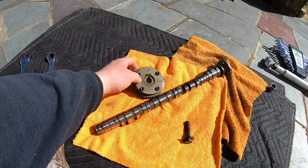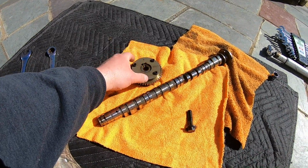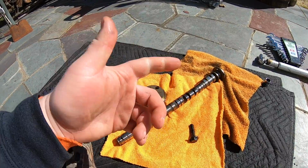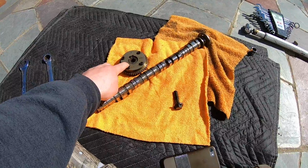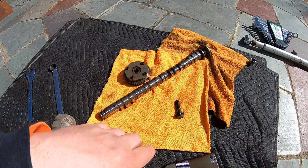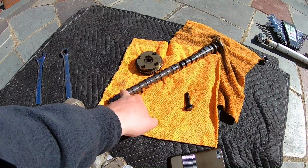I need to make sure that when I put the 50-degree VTC on, I either get it machined to have a lock on it so it won't advance past, I think there's 35 degrees, there's 40 degrees, and there's 45 degrees. Definitely going to go with a 50-degree, and I'm probably going to electronically set it just to be safe to like 42 degrees of advancement when I have this in the swap. So basically one step closer to getting the swap done.